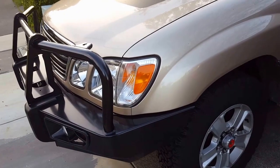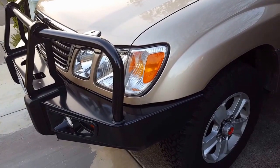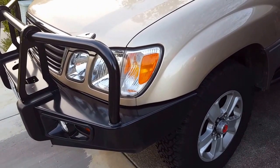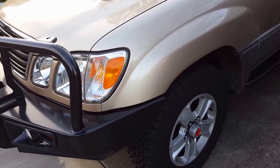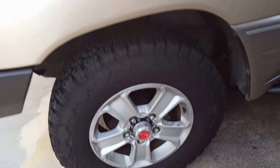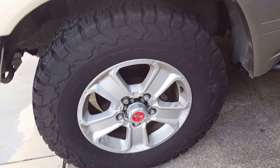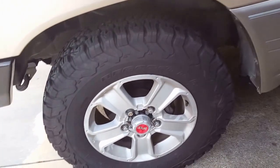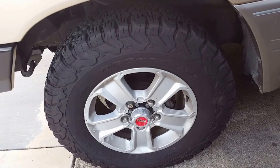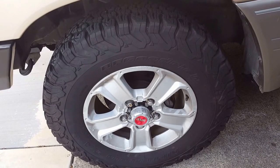Here's my 99 LX470 - the Lexus, a brother to the Toyota Land Cruiser. I'm putting a part-time four-wheel drive kit on this, got it from Lok Loka. You can see I've already got the front manual hubs in place. The other part of this conversion is a spool, and the transfer case is a little more complicated than the hubs, so I'll get going on that.